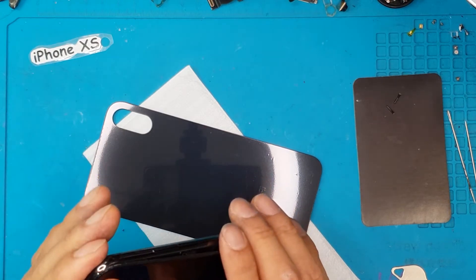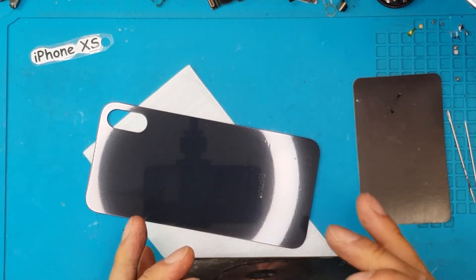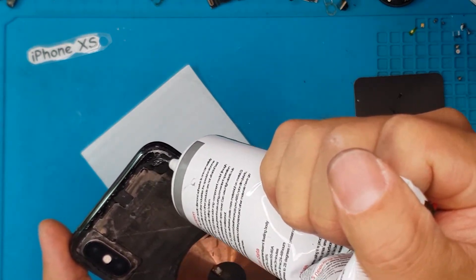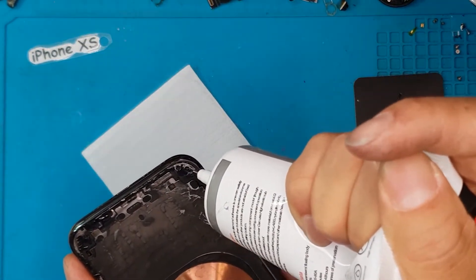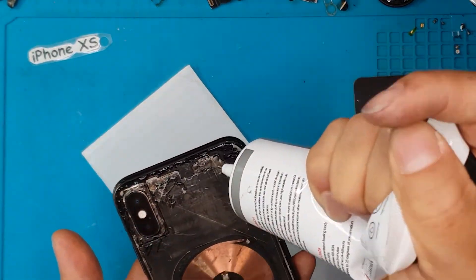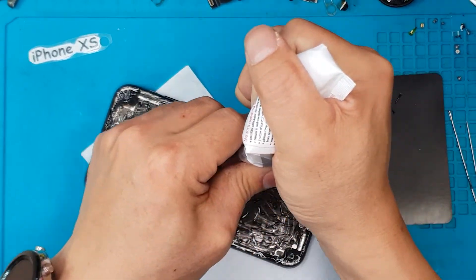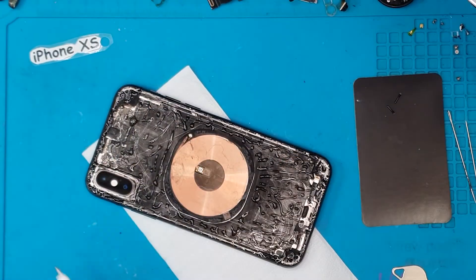We're going to put the display back for good. Since we've tested all the components — the camera, charging, and buttons — all seem to be working. Now we put new adhesives on the sides to make sure the replacement back glass will adhere to the surface and maintain a level of waterproofness, although we can't guarantee it will be exactly the same as factory. We apply adhesives on the housing, except for the charging pad. That copper area is for wireless charging, so we steer clear of it, just like the laser did.